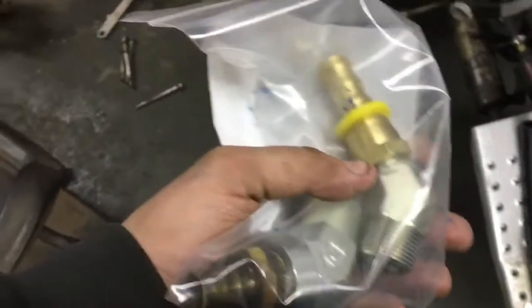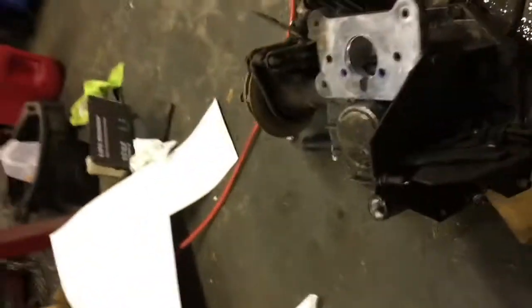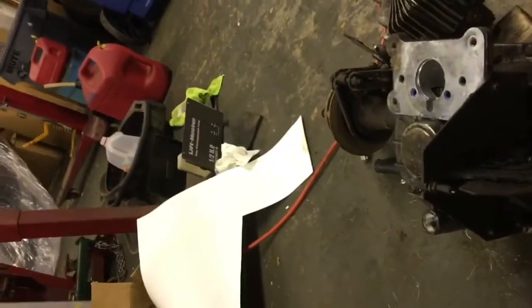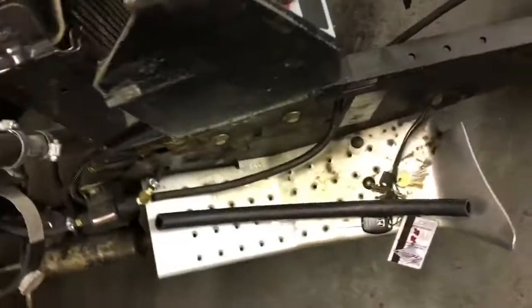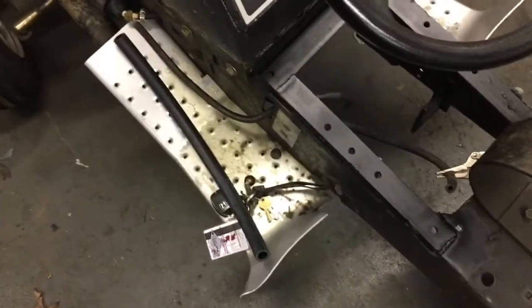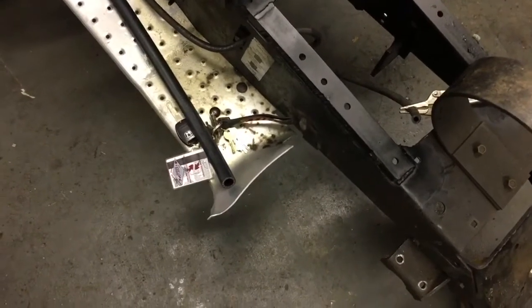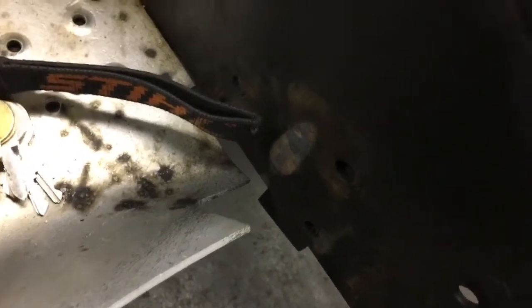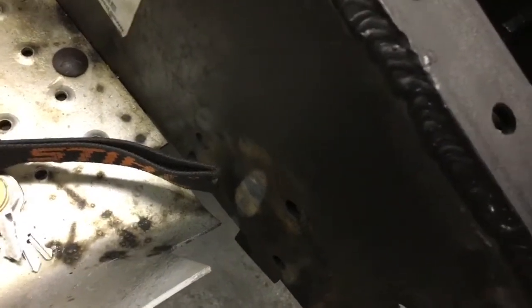While I was out I picked up a couple fittings from Fluid Dynamics. This is for the suction hose on the bottom of the tranny. That port there — if we're looking at it like this, the hose goes up into the pump, and because it has such a wide arc it interferes with being able to use the rear mower deck mount. That mount is a lower mounting point, but more importantly it's a structural item. Now that I look at it, these tranny mounts occupy that rear hole, but I could probably modify it to make it work anyway — it's just a handy thing to have because we're looking for frame reinforcement.